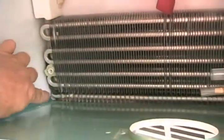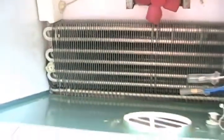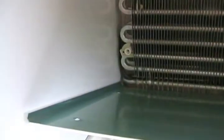The other electrical part in your fridge is the heating element. It's always at the bottom of the cooling radiator, or evaporator. One type looks like a stove element, and another kind looks like it's inside a glass tube.